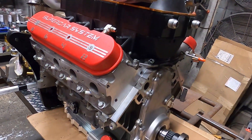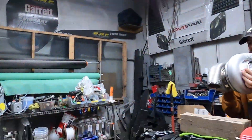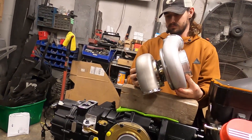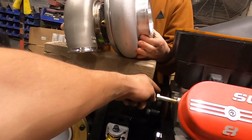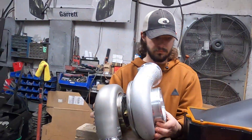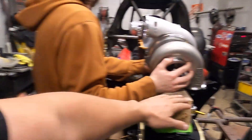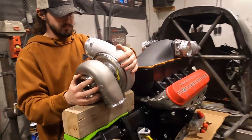We want to get real silly. So we could even go further forward - picture a nice smooth 45-degree bend. Slide it back a little - I think that's probably it right there, because this comes down real nice here. We could do a crossover, come down here to a collector, and then do whatever with the exhaust. Maybe we'll end up going single with just one throttle body, do a nice bend off of it, lower, and come right in. The third element's going to mount probably right here, so obviously we'll need a heat shield and the exhaust comes right out the back, right below the rear wing.